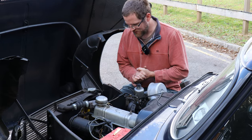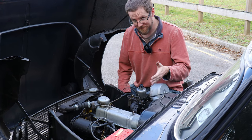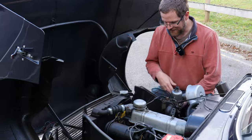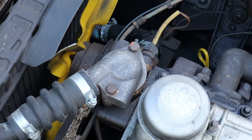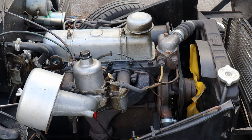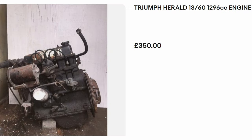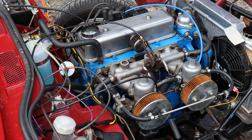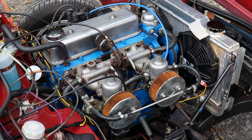The specific thing to mention is that these engines are known for quite weak bottom ends — particularly the crankshaft thrust bearings wear rapidly. This shows itself as excessive free play in the front pulley crank: when you put your clutch down the front pulley will move forward when the engine's running, and if it's really bad the revs will drop because the crankshaft is being pushed forward against the bearings. At that stage the engine could be a write-off, but engines are easily found second-hand and easy to rebuild. Upgraded engines — Spitfire spec with twin carbs — are common, but bigger engines are more prone to that bottom end trouble.